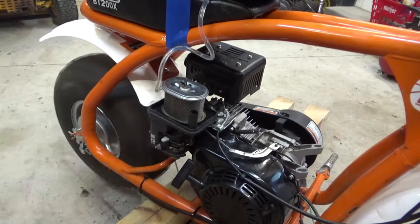Okay, so after farting around with that ring for a while, I think we got it off, there it is. That was the ring that's holding that guy on. So now that whole assembly should just slide out. We don't want to mess with that post at all, because otherwise we'd have to drill and tap that hole and plug it with a screw. So we can leave that just like that, because that's not going to interfere with the engine at all. We'll only have to drill and tap and plug this hole up on top here where that arm was sticking through.